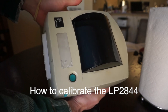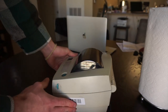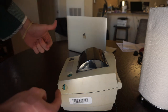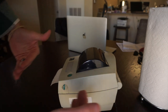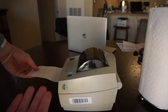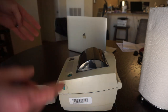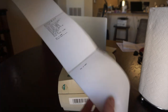Make sure your printer is in the off position — the switch is pressed down. Now you're going to hold the front button and turn the power on. It's going to start blinking red. You let go and then you will see that it starts going — it is calibrating. The sensors in there are trying to read the distance between the media, so it's going to take 20 to 30 seconds. It's going to print out three blank labels and then an information label at the end. You'll press the feed button one more time and it should be done calibrating.